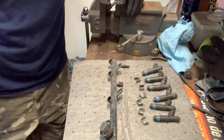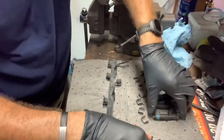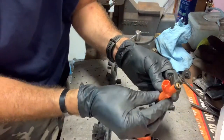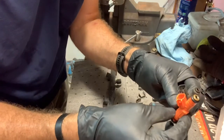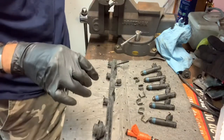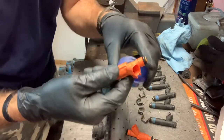New fuel injectors — nice and bright. They're similar where it counts, which is the connector. Overall length is the same. The first thing you're going to want to do for each one is get a little Vaseline, and before we insert these, lube up the O-ring. Just enough so it doesn't tear the O-ring.